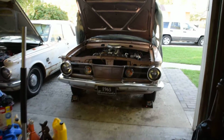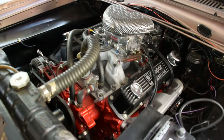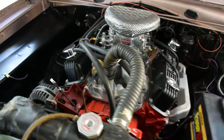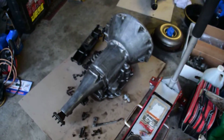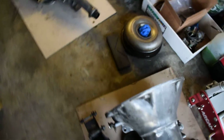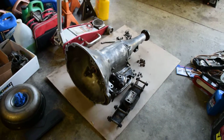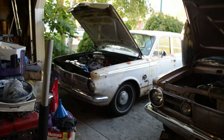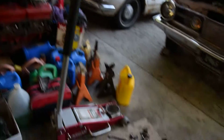We got the 1965 Plymouth Barracuda right here. Got the Magnum swap in, and performing pretty good. Only one problem: I had to pull the 904 transmission out again, which really sucked, but was a lot better compared to pulling the 904 out of the 65 Valiant right there to replace the input shaft seal that the torque converter seats against. That little orange seal right there.